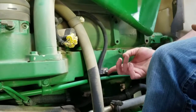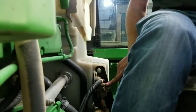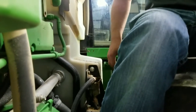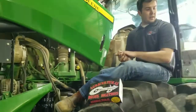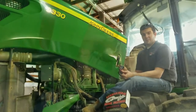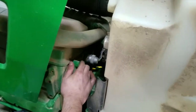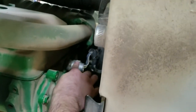You can see here on the intake manifold, it will be going for our ground — that's a good solid location. And then for the power, you will see a power junction going to the starter right here next to the fuel tank. So those are going to be our key connection points for this module. Stay tuned for step-by-step follow-up. We're now going to start this install with our first connection point, the injector connector on the back of the head.